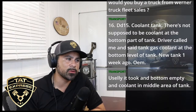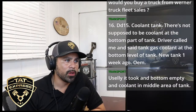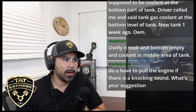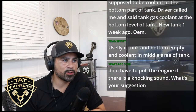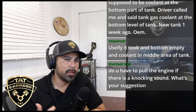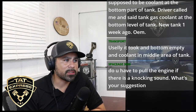The same thing with diesel. So, I would put fresh diesel in it, put some fresh filters, fresh oil, check the air filters, go ahead and grease the truck, do an inspection on it. Expect some wheel seals to be leaking if the truck has been sitting for a year. A lot of times those wheel seals will get dry, so once you start driving it and it starts warming up, then you will have some leakage. So you can actually be looking for that or expecting that.